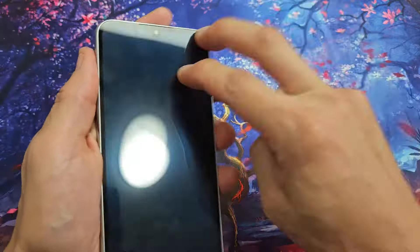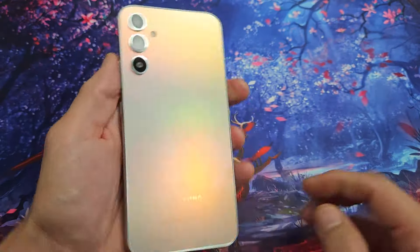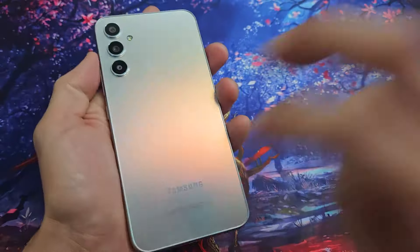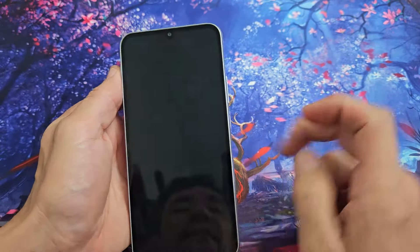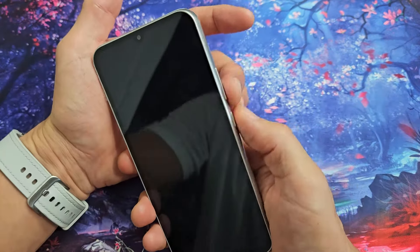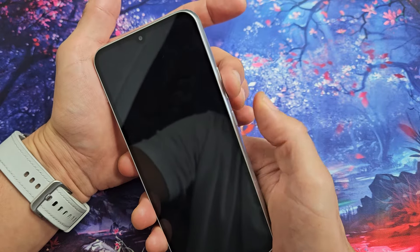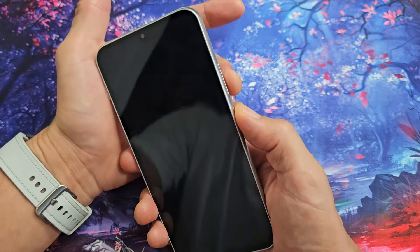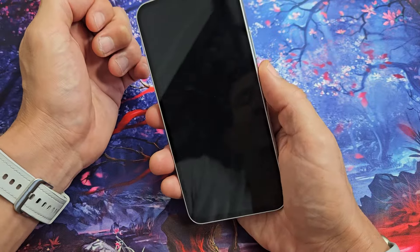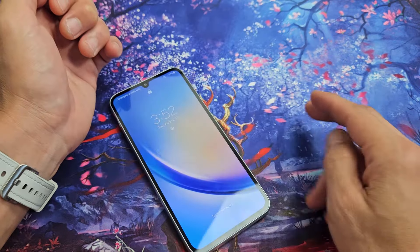Keep on tapping. If you hear a little click while tapping, tap on that power button and see if your screen is on. Tap kind of hard all over — on the sides, everything. Same thing on the back, and also tap all around the lens. Turn the phone over, tap that power button, and see if your screen is on. If it's still black, force restart it again with the two-key combination — volume down and power — press and hold both buttons until you see the Samsung logo appear, then let go.